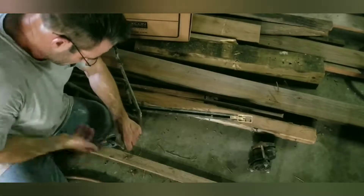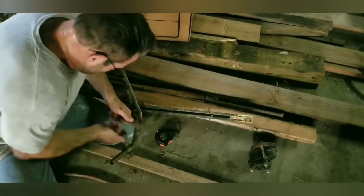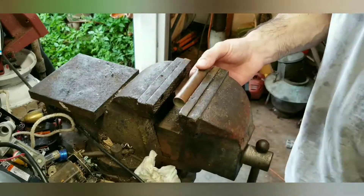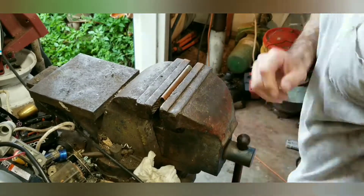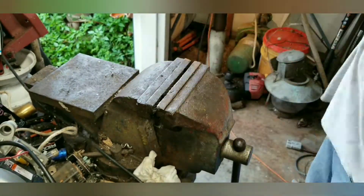Down in the bottom of the golf cart, I have two batteries that are there but electrically disconnected from the whole rest of the golf cart. Today we'll be getting rid of one of them, but the problem with just taking them out is I've been using the posts on the battery as a place to bolt my lithium packs. If you take out the battery, you lose a mounting point, so you've got to make up for that.